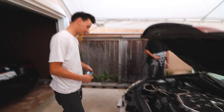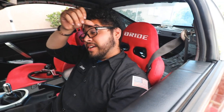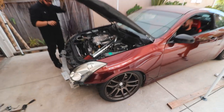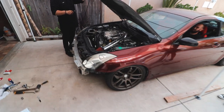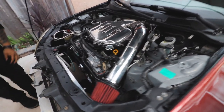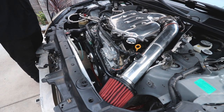This is how you check if the pulley is installed correctly. After starting the car, it's squeaking really badly and smelling like it's burning - either not aligned or not tight enough. We're going to tighten it a little harder and turn it back on. After tightening - perfect.